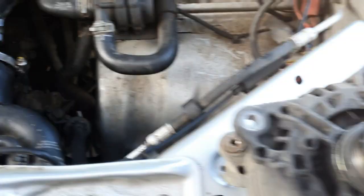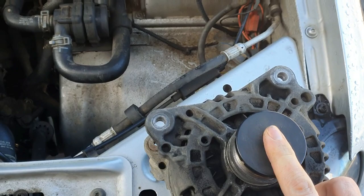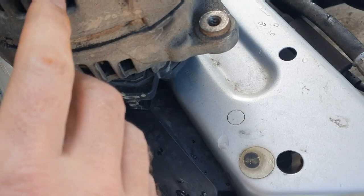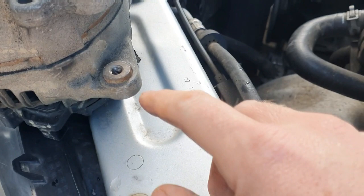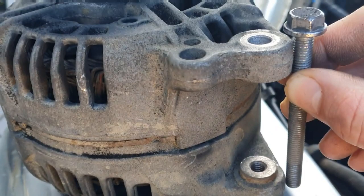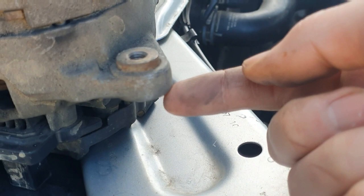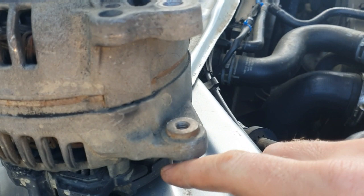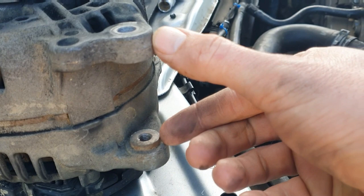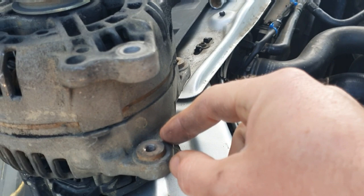There was a question about how to make the alternator come out easier. For the first time you'll need a pry bar to get it out, but then what I do is put it on a bench vice and screw in the bolt until it's sitting just a little bit higher. While supporting the alternator underneath, I hit on that bolt from the top to drive the bushing in a little bit deeper so there's more clearance to wiggle it into place. Do this on both sides and the alternator removes much easier.